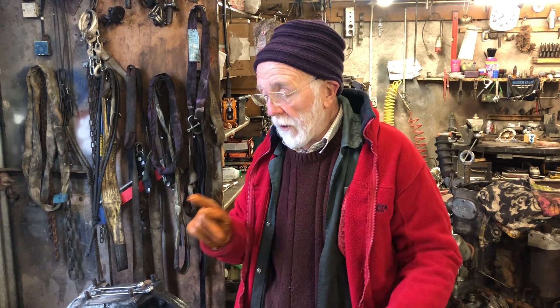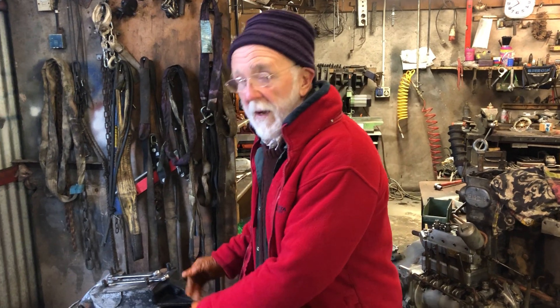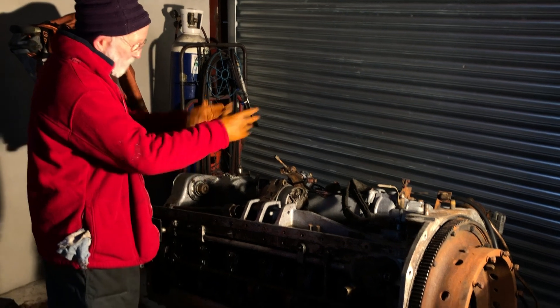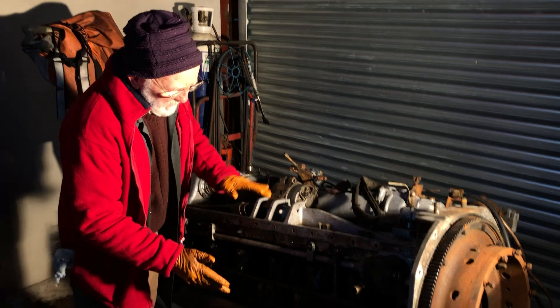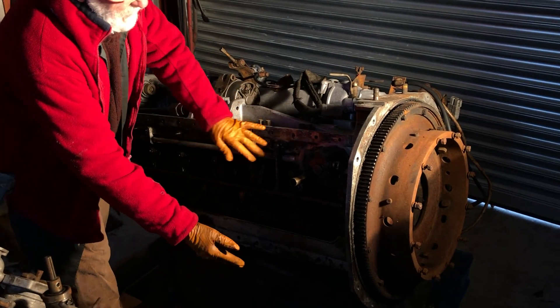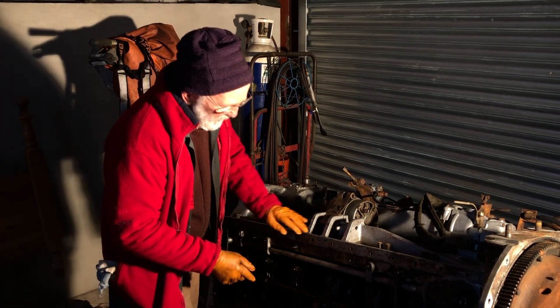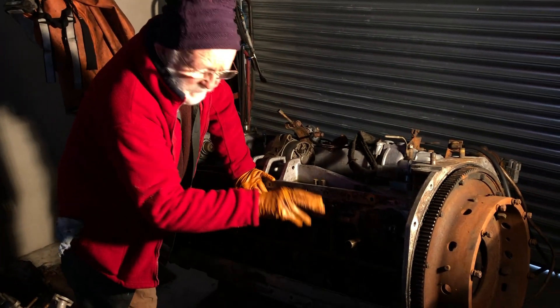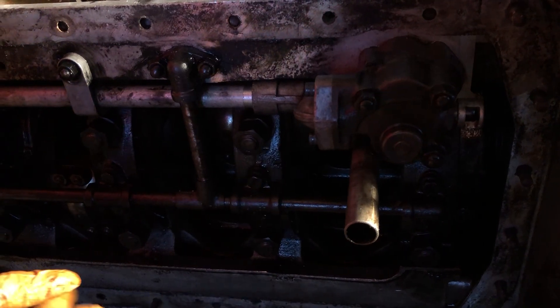So what we're going to do now is pop quickly and just refresh your memory on a conventional rear pan sump, and then we'll come back to this one. Here we have again a 6LXB, very like the last one you saw, but the sump pan is at the rear of the engine next to the flywheel. This is the most common type. You'll notice that this tube here — I've shown this tube before in other videos — this tube here simply sucks the oil in from that sump pan and the oil passes up through the crankcase and up through the engine.